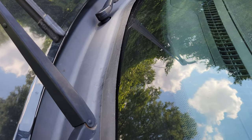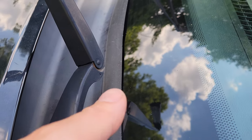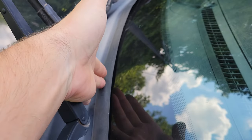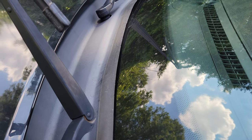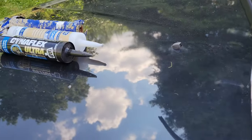You could even cut off the old part of the seal right here, which is what we did on the BMW. They make a seal that fits over top of the piece here with an extra flap that holds against the windscreen, so you could use that as well. But again, that's going to cost you — so the best bang for your buck is probably using the silicone.